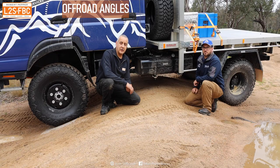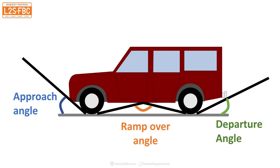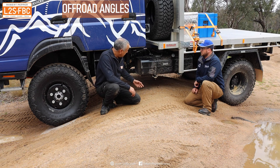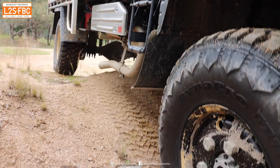Looking at off-road geometry — that's your ramp-over angle, which is the slope you can go over, and the approach and departure angles. That's really critical for any off-road vehicle because if you run out of angles or clearance you tend not to be going anywhere, no matter how good your traction systems are. There's some concern about bolts hanging down with no underbody protection.